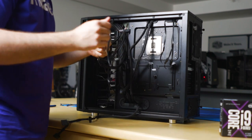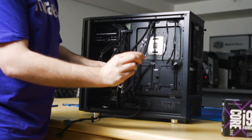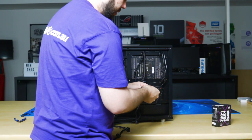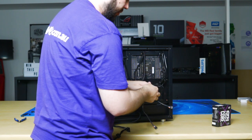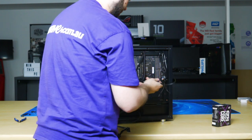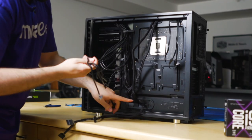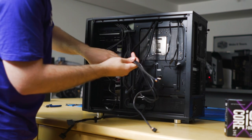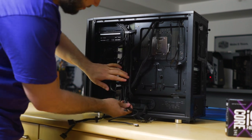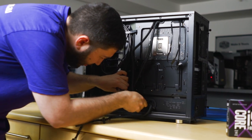Okay, so these are your front panel cables. So they're labeled. So this one's HD audio. So that's if you want to plug headphones in or a microphone in to the front of the PC. This is a USB 2 header. And these are required for the power LED, power button, and reset button to work. So all of these connect at the lower portion of the motherboard. So you would like to use the lowest grommet. Again, try to minimize the overlap if possible. You can always fix this up later.